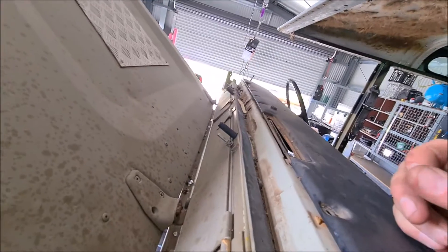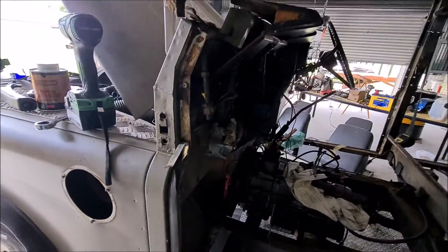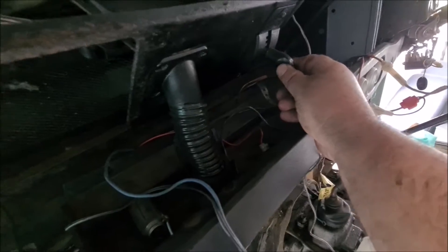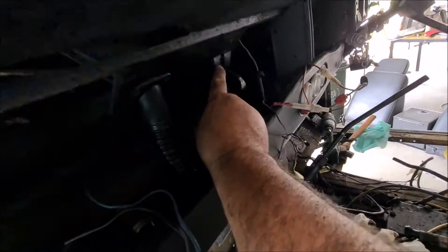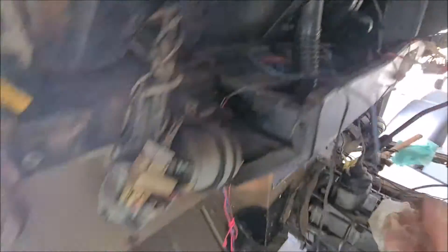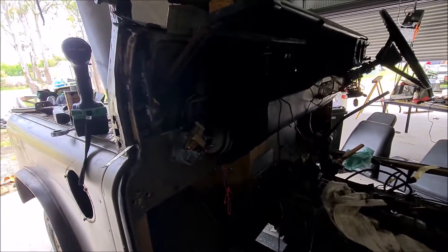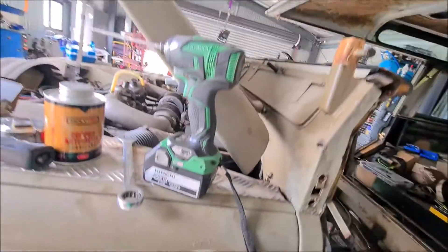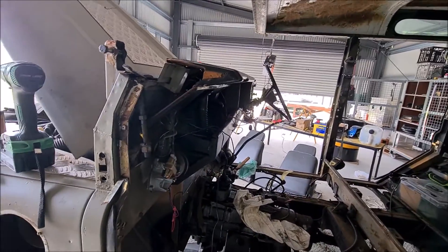The windscreen is over in the storage area - it's all galvanised, I'll clean all that crap out. The dash is probably the next bit that comes out, and then the ventilation flaps. I know I've got a couple of stripped teeth on my vent flap mechanism - I think it's on the driver's side one. One of the little teeth in there is stripped and doesn't close properly. It'd be a bit much to try and weld it and file it back, so I might pull one off the other ute. Anyway, that's the progress shot there.